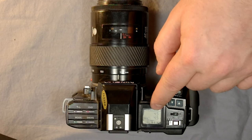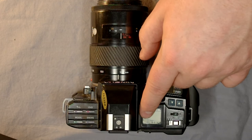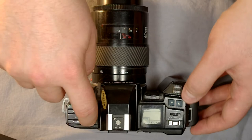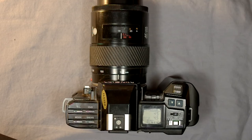Here's the LCD screen. Along the top it tells you what modes you're using, with shutter speed on top and aperture on the bottom. The film counter shows how many frames you've used. S is for single frame — you push the button and it takes a picture. In continuous drive mode it takes multiple pictures and keeps going. ST is self-timer and it counts down, which you can see on the top display. The main switch has three positions: beep turns on a speaker, on turns on the camera, and lock — note this is not an off button. Even in lock mode the LCD is displaying information, so if you want to prevent battery drain you have to remove the battery.